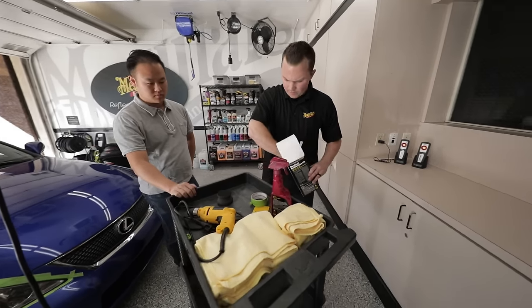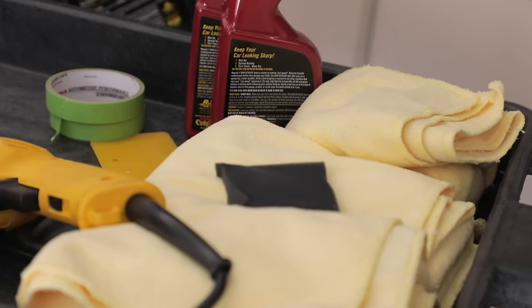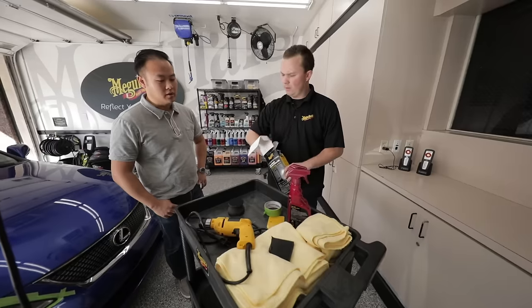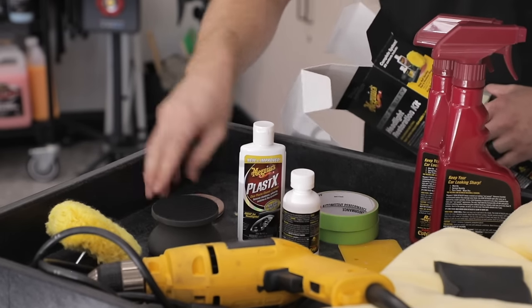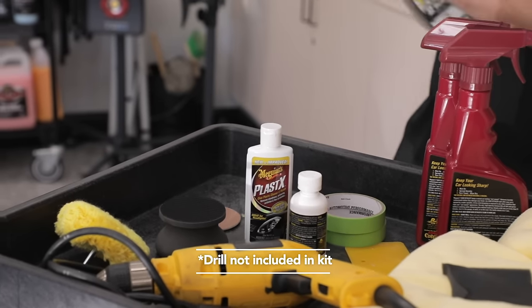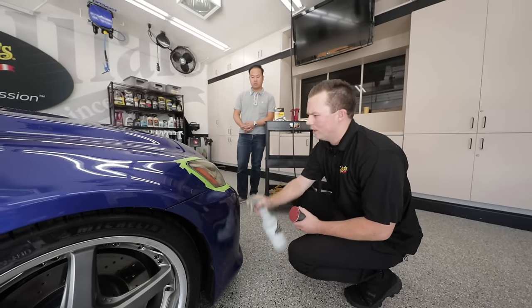Here's what we've got: a hand pad for the wipe-on coating, a plastics wool pad, two sanding discs, and our drill. We've got our 1000 grit disc and we're going to sand vertically in straight lines.